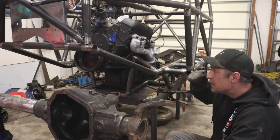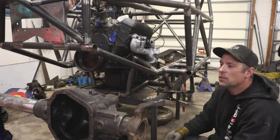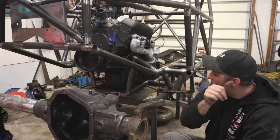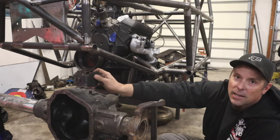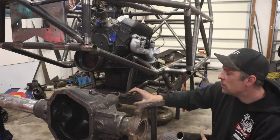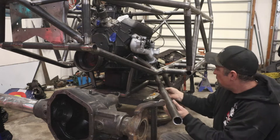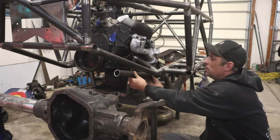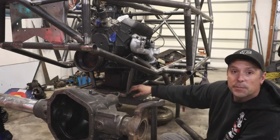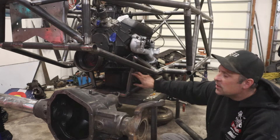For now I've just got these motor mounts and skid kind of tied together because it's not 100% — things could change with the front suspension. I have to imagine that the truss down there is going to be on top of it, so the top of the truss is going to be right around here, and then I'm also going to have link mounts on top of that. You can see how fast this gap right here starts to fill up. One thing I have to consider is a driveline that's going to go right here — it's going to be two-piece, ending right here at this tube, so these two will tie together like that. I've got to have room for it to articulate, and one thing that happened with my other build is when the suspension drops out, the driveline can get pulled over into the skid plate, so that's something I may have to make a change on.